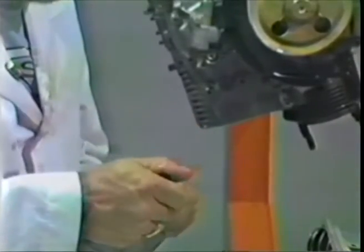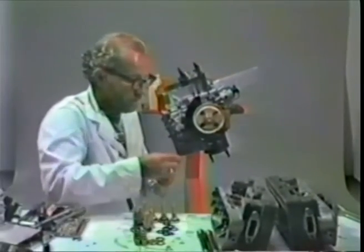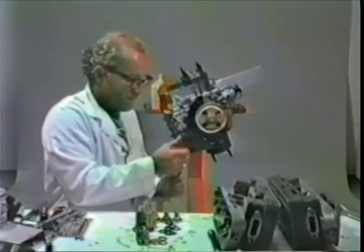I have seen new pushrod tubes bent where they come from the importers with defects, but you inspect it, inspect the seam, inspect the convolutions, inspect the ends for being bent or whatever. And if they are bent, reject them, as they're hard to fix. Anyhow,